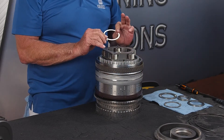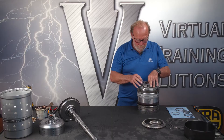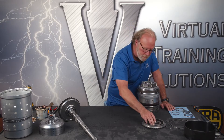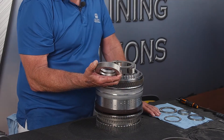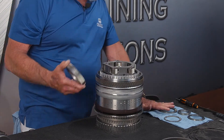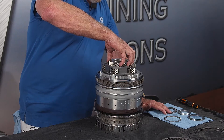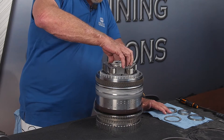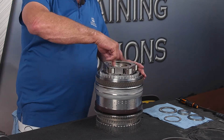We've got a three-tang washer to put down in here. It doesn't really need any assembly lube to stick the washer down because once this whole assembly is together, this sun gear isn't going anywhere. For the P3 sun gear, you want to look at the teeth for breakage or wear — if it's broken, that other part is going to be broken too. It is splined to the clutch hub, so when the D clutch is applied, it turns the sun gear.